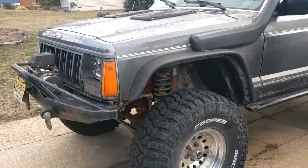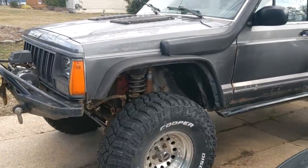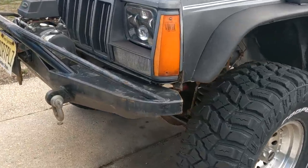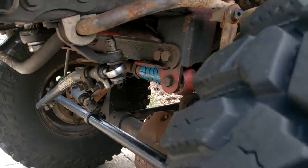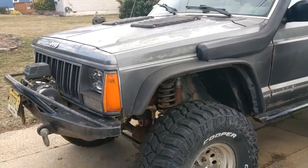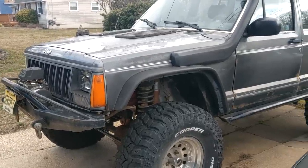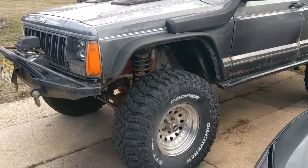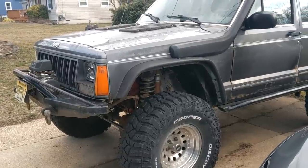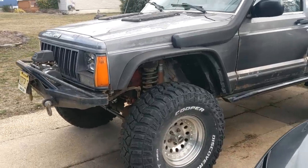And don't even let me get started on that RAM. I wasn't even sure if I was going to go hydro assist. I didn't get to look up kits or mounts, or how people do it, or if I could even run it on this particular axle — I've got a Dana 30 with the CAD motor, so the big passenger side mount gets in the way and there's not a lot of room. The fact that I got wrangled into that kit when I wasn't ready to order it — and then to find out it's the wrong size. They have a 6-inch kit and an 8-inch kit. The 8-inch is for aftermarket full-ton axles and the 6-inch is for regular half-tons. I told him straight up this is a stock axle — everything's stock. The fact that he sent me an 8-inch ram just drives me nuts.